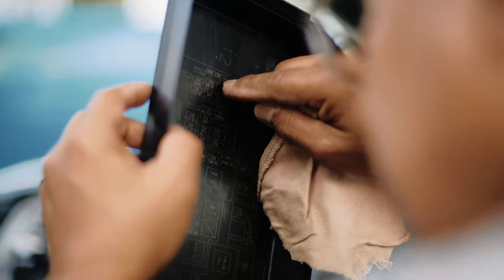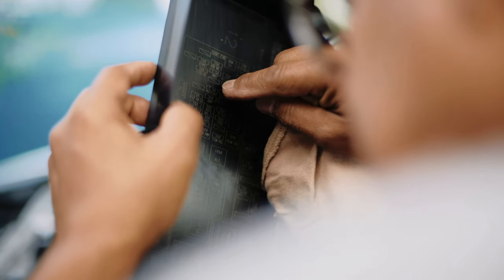We decided to go with the INJ 1, which is for the fuel injection. I watched a couple of tutorials and that's one they used. Basically you just have to pick one that turns on when you turn the car on so the lights turn on.